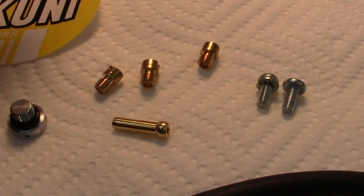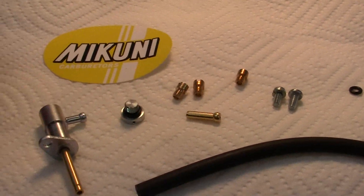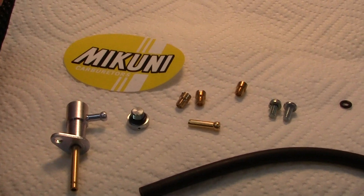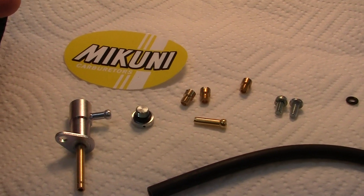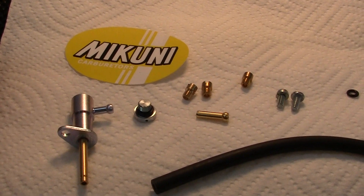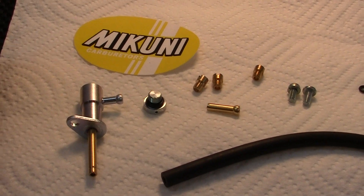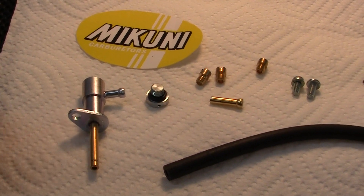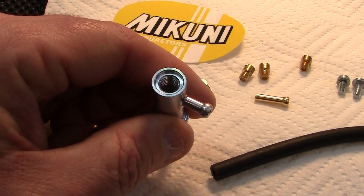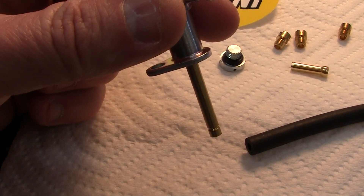With the power valve, these jets are only for the valve. What we're trying to do is — at high speed riding I've gotten up over 70 miles an hour, but for some reason I can't quite get there, usually within five miles or less. I don't know if the carburetor is leaning out. What this does is shoot extra fuel into the Venturi at high speeds.